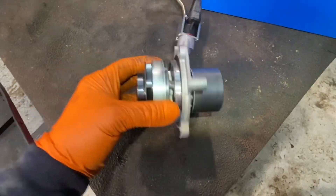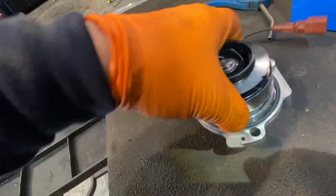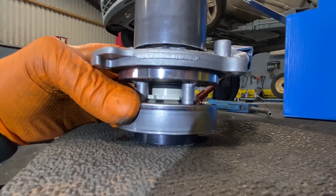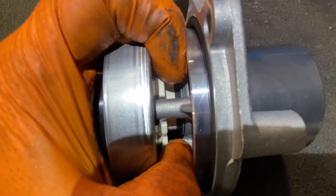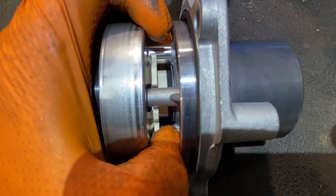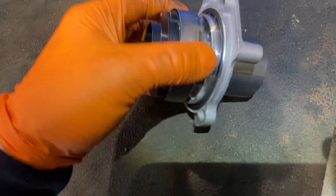Here is the new water pump with the control solenoid on it. You can see that the shroud slides down over the impeller nice and freely and pops back in nice and freely. As I've said before, it's that little seal — the black gasket between the white part and the aluminium — that actually gets ruptured, marked, or pitted, and that snags and stops it from going back in. That's the cause of our overheating issue.